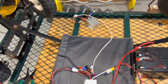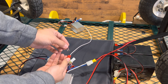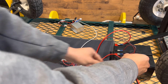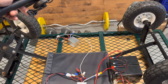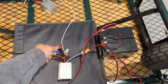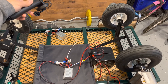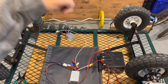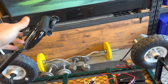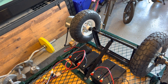If I press the throttle it doesn't move — that's because we forgot the little jumper. Let's go ahead and disconnect that, put in the jumper, and then reconnect it. Now the throttle should work. See? Without that little jumper that's what's going to trip you up — if you don't have that jumper it's not going to work. That's how we wire it up, and now to tie in to the other side — it's all wired up. Throttle: go, stop, go slow, fast!